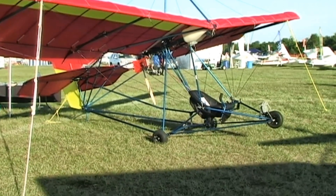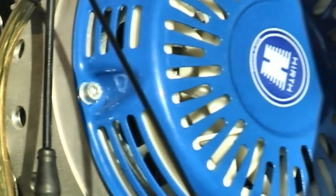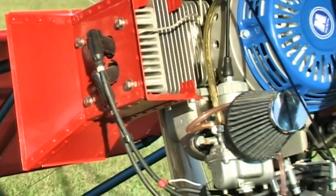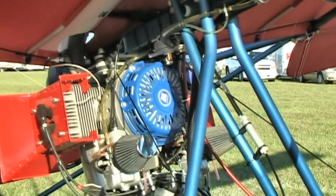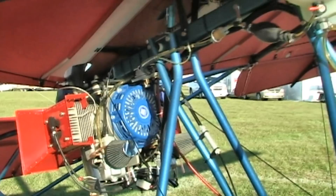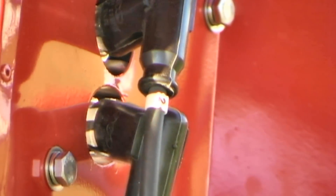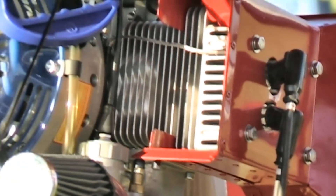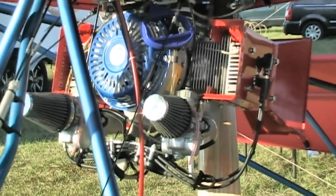One downside of having so much power on an ultralight is you're limited to five gallons. But with this much power, they're able to pull back and cruise at 3,800 to 4,000 RPM. So it's going to be quite quiet. In that RPM range, this engine runs extremely lean by design and they're still only burning two and a half gallons an hour. So you're going to burn a bunch if you want to climb like crazy, but that's only 10 minutes or something.